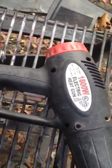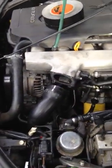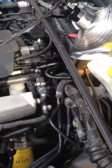So I went and bought a dealer OEM part. I had to charge the customer again because he talked me into the aftermarket. There are a couple of guys on YouTube who show all the tips and tricks for this job — worth watching. Before you put anything back in, put a little bit of grease on the o-ring. Also make sure you get the o-ring out of the coolant temp sensor hole — if it doesn't come out with the sensor, dig it out. When putting the sensor back in, put a little weatherstrip on the outside where the o-ring goes and let it sit for a couple minutes so you don't fumble around trying to get it in place.